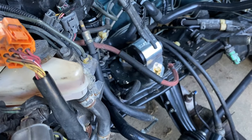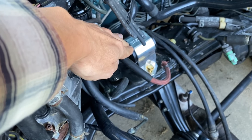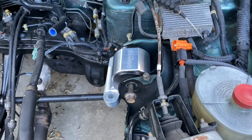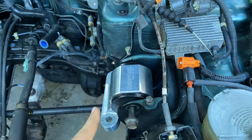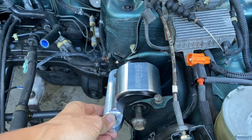So for this rear mount, there's going to be access right here, reaching down with the ratchet and extensions and swivels and whatnot when the motor goes in. And for the orientation of the driver's side mount, once that engine goes in, it basically just falls right into that channel. It'll drive that bolt right through. And that's basically how this motor is locked in position.